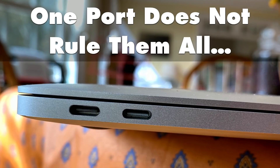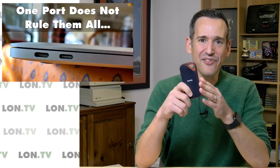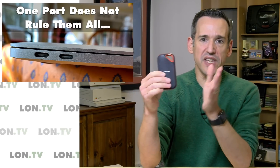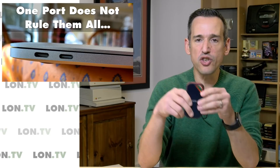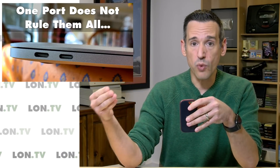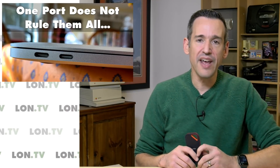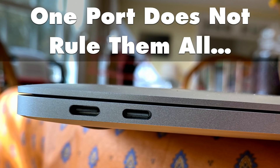What prompted this week's discussion was a product review I've been working on over the last couple of days, trying to figure out the best way to explain this mess to people. We got in a couple of these new SanDisk portable SSDs free of charge — full disclosure — and they have two drives available: the Extreme Portable and the Extreme Portable Pro, which supports the USB 3.2 2x2 standard. This newer USB standard allows transfer rates of up to 20 gigabits per second, and if you've got it plugged into the right port you can get pretty good speeds, but most people don't have support for that standard. Many people in the future may not be able to use this drive to its full potential either.